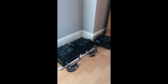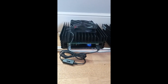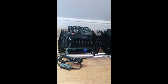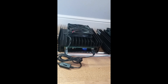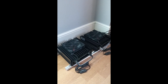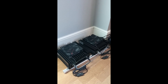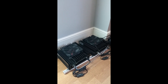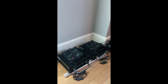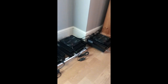A couple of things I've done: I've obviously removed the end panels — it's really easy, literally just four screws on either side and they just drop out. I've updated the power supplies; I've got 180-watt laptop power supplies which cost me approximately £25 each, so it's probably about a £60 upgrade — maybe more like £100 by the time you buy the fan and pay for the actual firmware itself. I believe it's justifiable.